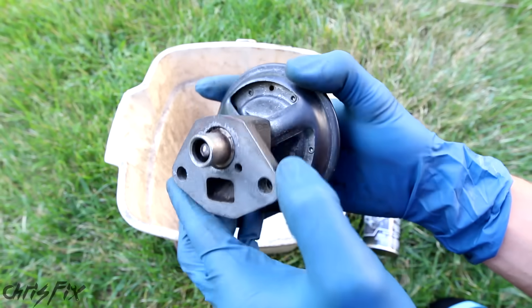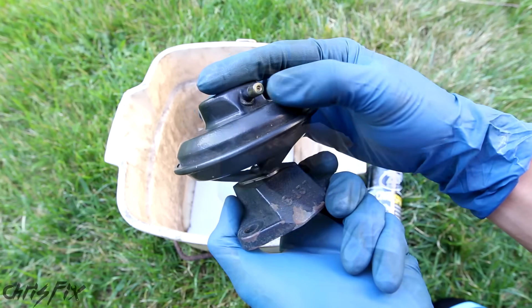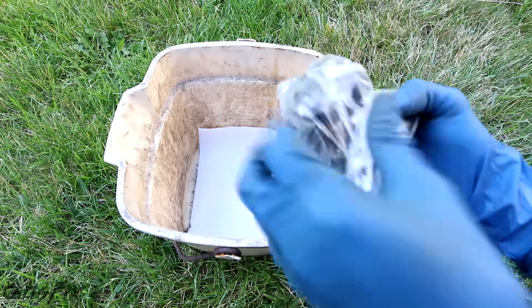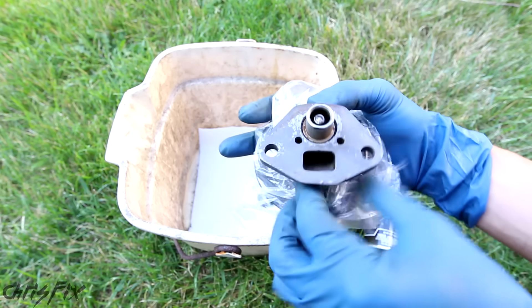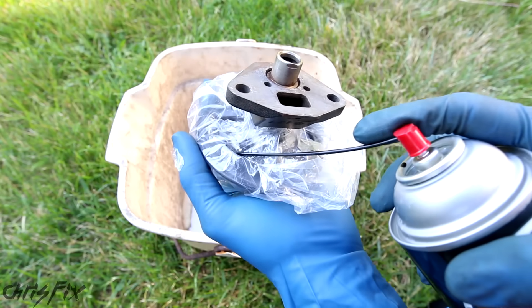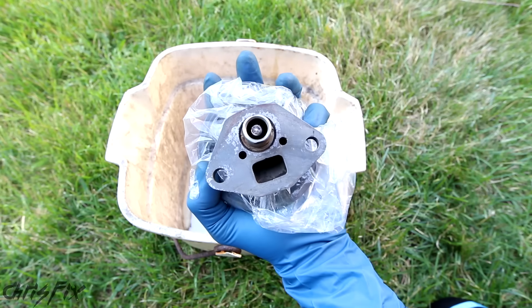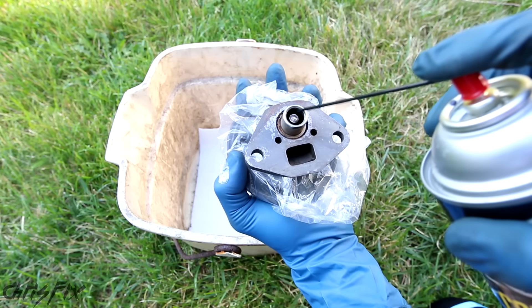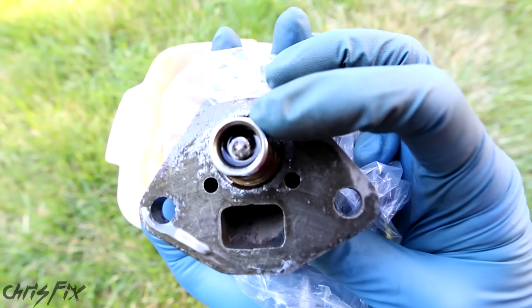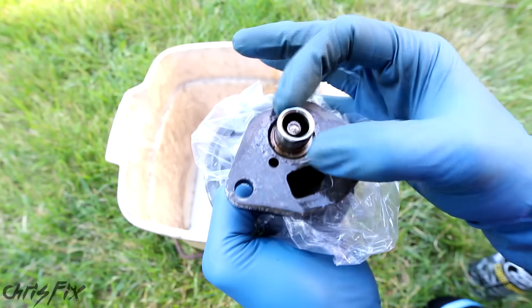When cleaning the EGR, the only thing you want to spray is the carbon buildup in the valve opening and valve stem area. You don't want to spray in the diaphragm or the vacuum port. If you have an electronic EGR, don't spray in the electric motor. To prevent damage, get a plastic bag, break a little hole, and push it through — this plastic protects the rubber diaphragm while you're spraying. So if it leaks over, it won't get into the rubber or the electric motor. Fill the top opening with cleaner — a closed valve should hold liquid. If it's all leaking through, that means carbon buildup is preventing the valve from closing all the way.